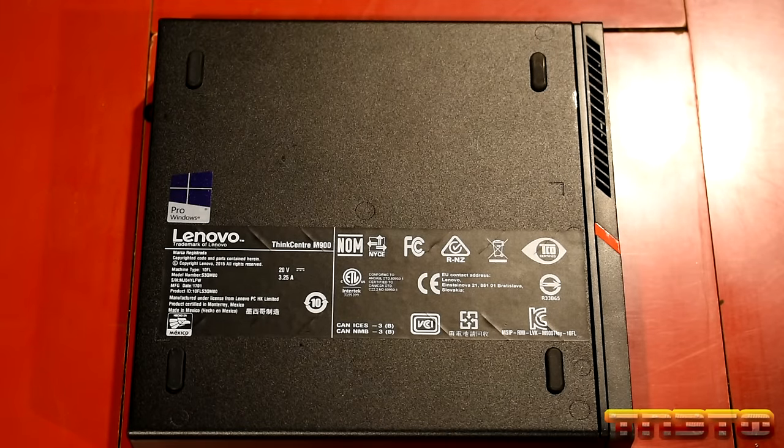Then we have system information with F1, which is very nice. They give you a nice menu, shows you the BIOS version. We'll make sure the BIOS version is the latest and greatest. It's not too badly outdated, 2021, so that's not bad. Get the serial number. You can pop in the serial number over on the Lenovo support page and get all the information about the unit, how it was default configured when the previous owner bought it, which would have been a business,